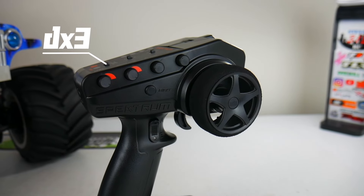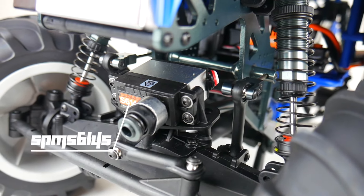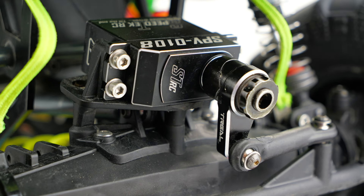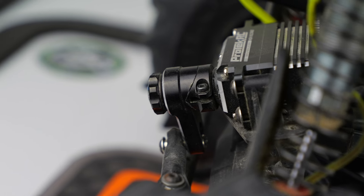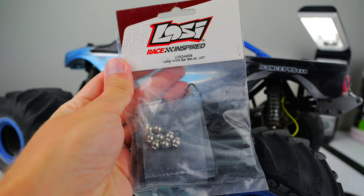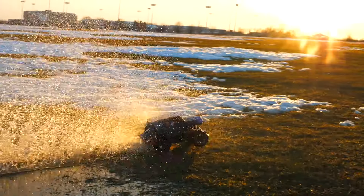The stock transmitter and receiver are solid, but the steering servo up front is the weakest link. For a ready-to-run servo it gets the job done, but it's definitely not the strongest or most reliable. If you're thinking about upgrading the LMT, the first thing I'd focus on is the steering servo and servo saver to gain some reliability and control. It's always good to have spare rod ends for the suspension links on hand. My biggest piece of advice is to just have fun with the truck and wait until you break parts to decide if you want to upgrade — you'd be amazed at how long some of the stock parts can last.